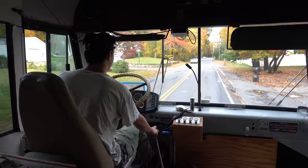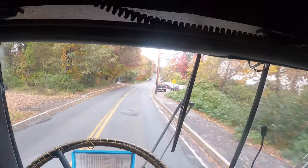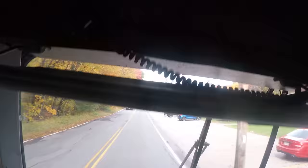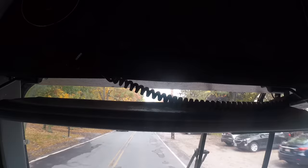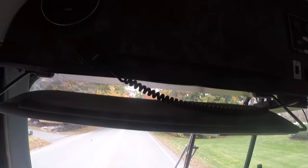A lot of people on a Facebook forum told me that on upshifts I should be in second, clutch in, neutral, clutch out, clutch back in, then over to third. But I found that whenever I do that it just doesn't work — I always end up grinding. Maybe I'm doing it wrong, or maybe it's something about this bus. On upshifts I hardly ever double clutch. On downshifts, however, you most definitely need to double clutch to bring the revs up because it's not synchronized. There's about a 12-car pileup behind me and I'm going a little under the speed limit, but there's a big downhill right here and I don't want to risk shifting to third — I'd lose a lot of engine braking.